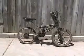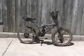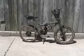This is my weed whacker powered motorized bicycle. It only is 22cc's. I had to modify the carb to make it burn a little bit more fuel to handle the extra power — it was bogging out. That was just scratching the jets with a pin. It's an Echo weed eater motor.